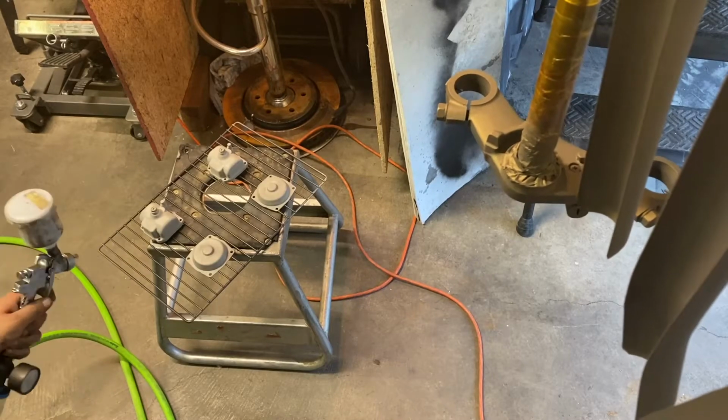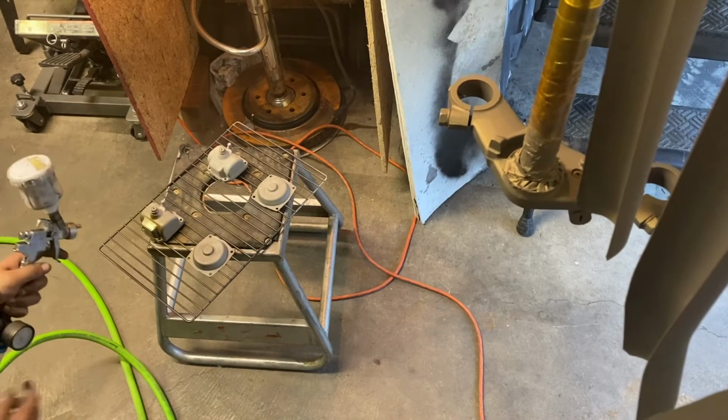step for now. So I'm going to go ahead and sandblast the bowls and top caps. The bowls are fairly soft metal, so we're going to keep a bit of a distance with the sandblaster. Other than that, it's basically normal. We put them in an acetone bath, and then gassed them out, and here we are coating them.